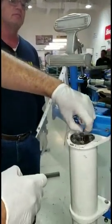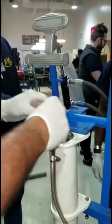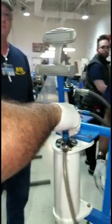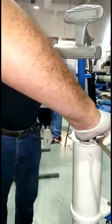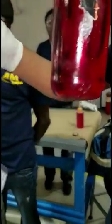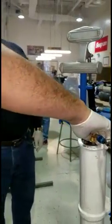First of all, he's going to take out the valve core, which he has done there. We've already disassembled the struts, we've reassembled it, and now we want to service it. For the Piper, this uses hydraulic oil 5606 — you can see it here, 5606. So you hook up the adapter we have, and now let's service it.